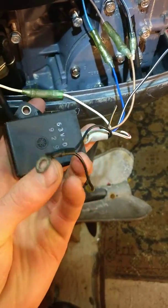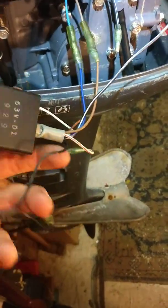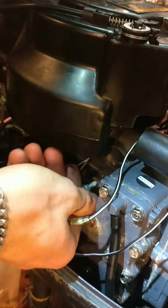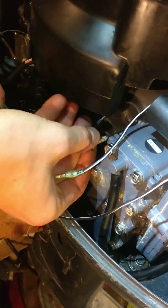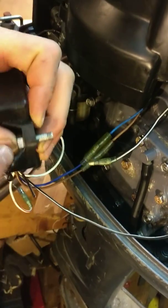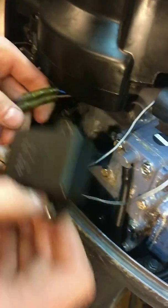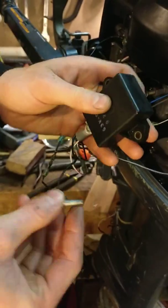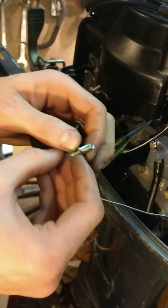When all these are fitted as shown, take your ground lead which comes out of the CDI unit. When you attach the CDI unit to the engine, put that through — take the bolt, and the bolt goes through the washer and through this, which attaches the unit and grounds it through the bolt. The unit fits just in here — don't over-tighten them because it will crack the plastic. When you want to test the spark, just take the spark plugs out, touch the edge of each spark plug to the engine casing, and they should both spark.